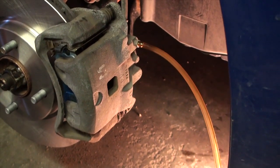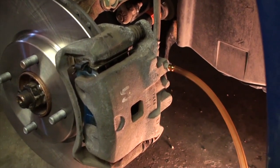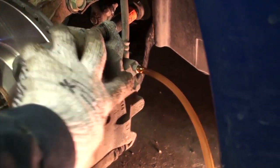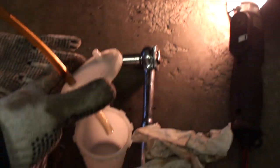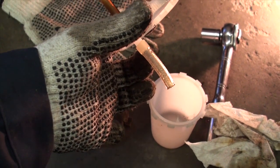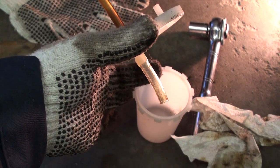What I have attached to my brake caliper is a brake bleeding tool. You can buy these tools for about 10 bucks at AutoZone, Canadian Tire, Princess Auto, or pretty much anywhere that sells things to fix cars with. You want to create a tight seal around this bleeder nipple, which feeds into a tube that goes into a little container to store the spent brake fluid. The little extension keeps this tube submerged in brake fluid so that every time you release the brake pedal it's drawing in fluid, keeping the fluid line solid so it doesn't let any air into the braking system.